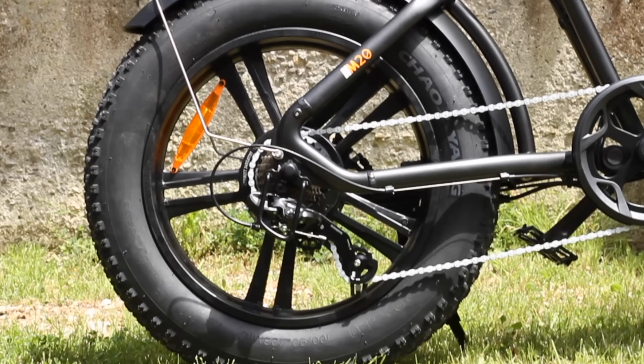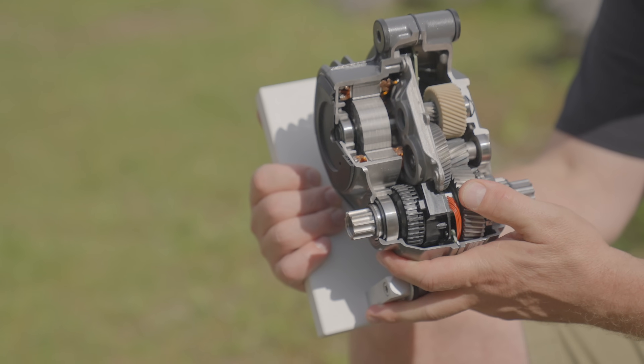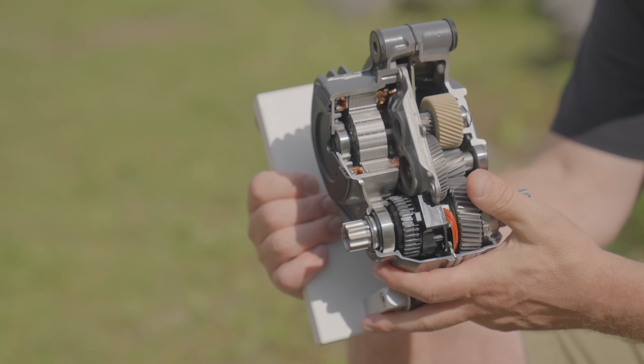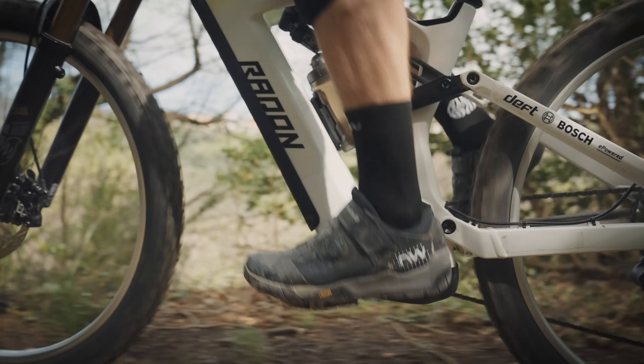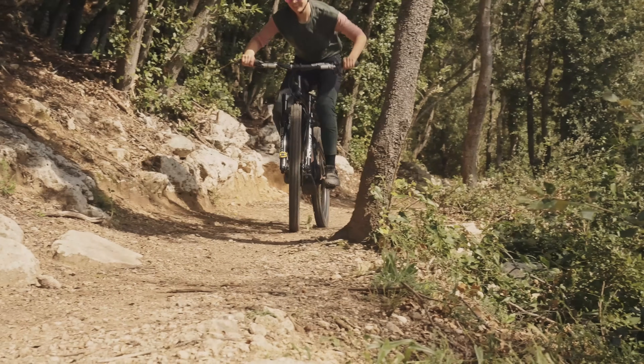This power is then exclusively controlled by the software in the controller because there is no torque sensor. So if I unlock this, I can go to 45 kilometers an hour with no fuss at all, just by turning the pedals with only a few watts of input power from my legs. After speaking to many motor engineers and what DJI have done, they've given the user the ability to spin the pedals with no torque pressure — just cadence as the main bias measurement — meaning the motor will output maximum power very quickly and easily. Whereas a system like Bosch probably uses more torque sensing, I can feel that Yamaha uses more cadence sensing. The multiplication factor can partly be based on the gearbox — in DJI's case a 1 to 40 — but also on the amplification factor of the rider input. So the answer for giving that power output is much more simple than the marketing would suggest. There's no magic taking place, it's literally a balance of cadence versus torque.